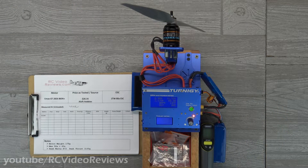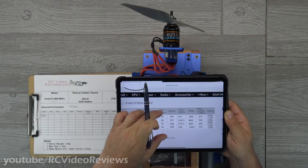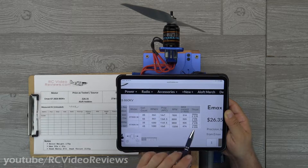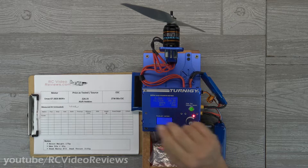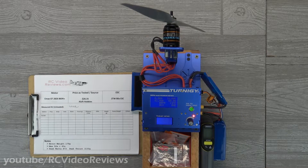I'm looking for something north of about 2500 grams of thrust and I'd like to see something north of about 750 watts. If I can get there I'll be happy with the performance on the airplane this is going on. Looking at the book: they're showing a max amperage of 51 amps on a 4-cell with the 860 kV and a 14×7 prop, which is exactly what I've got. So I'm looking for something north of 2500 grams and somewhere around 750 to 800 watts — that's the goal. This is not a brand new battery; I can feel it has a little bit of swelling on the side but it's not terrible. I do have another 4-cell on the charger if I need it.